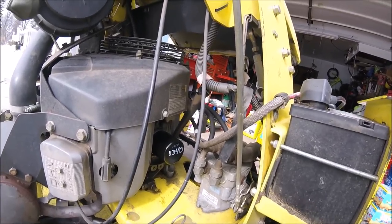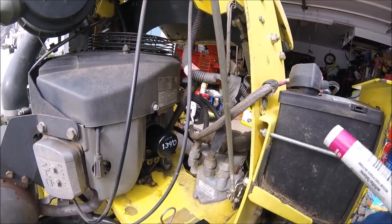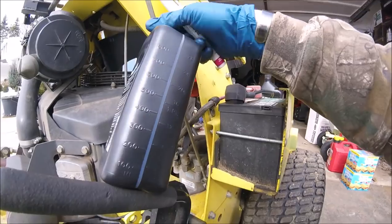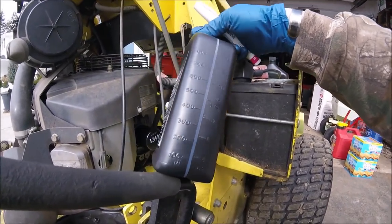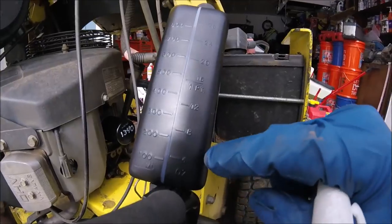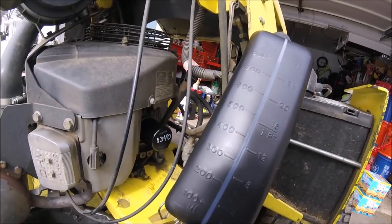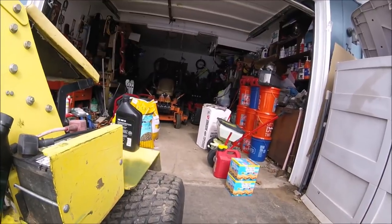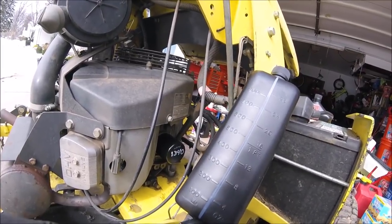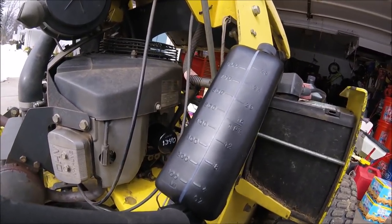This one is the same as the other ones - I use 10W-40, it's a Kawasaki engine. I use 10W-40 in everything. It takes one full quart and then all the way down to the 8-ounce mark on the second quart, so there's only 8 ounces left in it and that's almost perfect every single time on all my engines. This is a 19-horse, it's a 22-horse on the Scag, it's a 23-horse on one of my Walkers and a 19-horse on the other Walker. I put the exact same amount in every time and it comes out exactly the same.